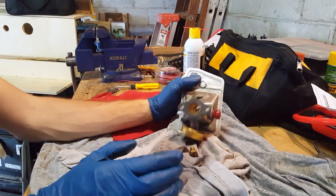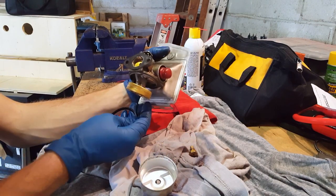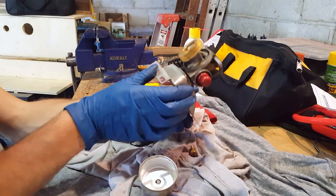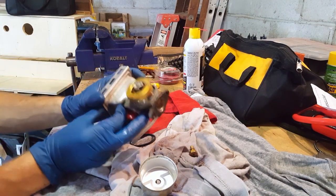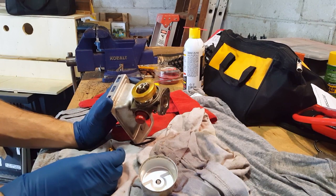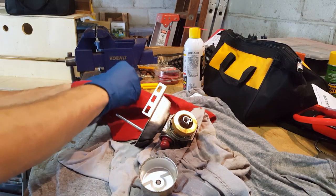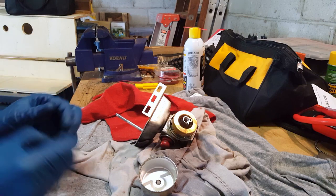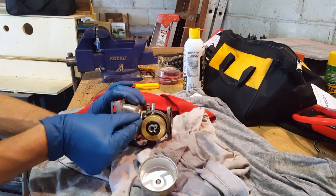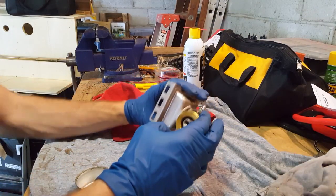We've got a clean bowl and a gasket that was just crushed. I don't know what's going on — this is goofy. It looks okay, I mean it's clean enough. I don't think anything's clogged. I'm getting fuel, but the problem is I'm getting too much sometimes. The problem isn't too little fuel flow — it's too much and it's not stopping.